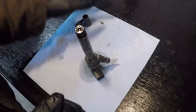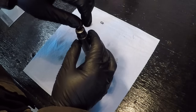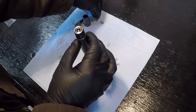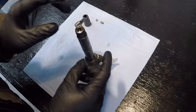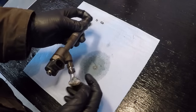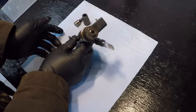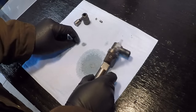If you try using a box-end wrench or a 12-point socket, anything like that, you run the risk of marring up and possibly stripping the ends of the nozzle holder. I've already changed all the nozzles on these injectors about six months ago, but due to the fact that I don't think I lapped the body of the injector correctly, all of the injectors leak around the nozzle holder very slightly — not a whole lot of fuel, just a little bit. So in the process of relapping these injectors, I figured I'd shoot a video and show you guys how it's done.